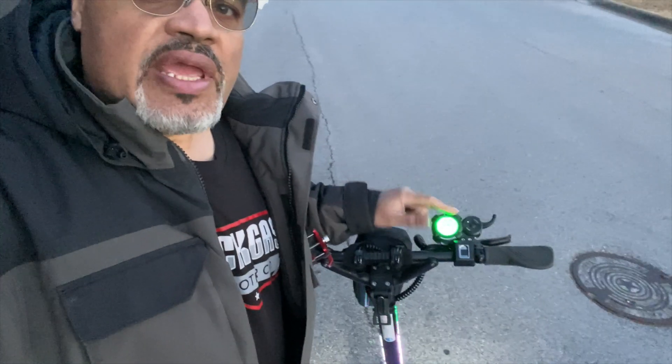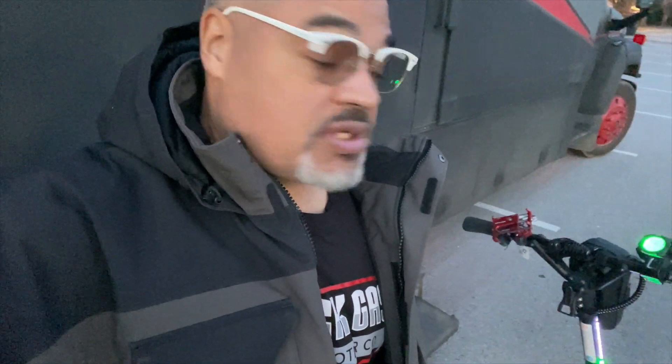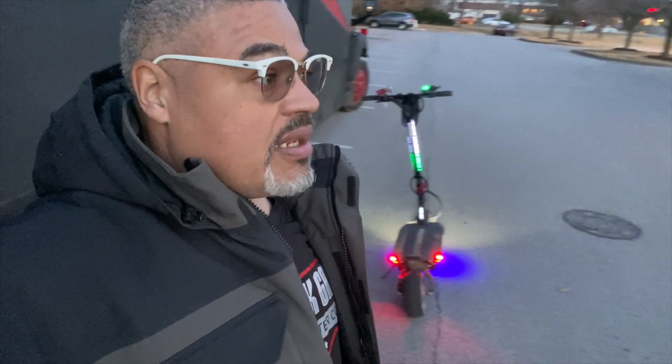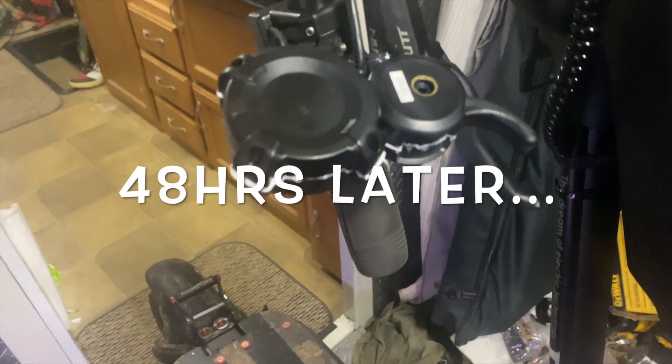I've been riding this thing all day with it full of silicone — not a problem. It's not raining or wet; I'm not sure I want to forcibly test that, but at least it's not messing up. If you ever have to do this, pump a little silicone in there — probably clear would be best — into your i3 controller. The best thing would be to get one of those covers that encase it, but the next best thing is to seal up all the little joints. You can't fully seal it because of the moving throttle, but I think it's a good idea. Make sure you like and subscribe!